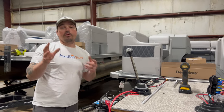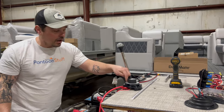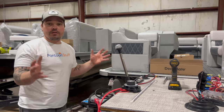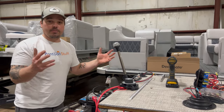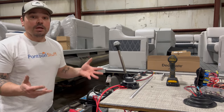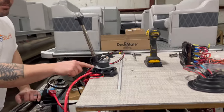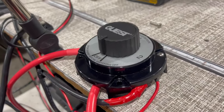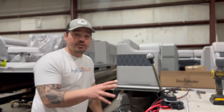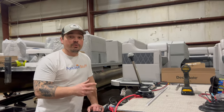The beauty of it is when I'm done with my boat for the day, I still have that off position that I can switch to — and then I have zero draw from my accessories or my motor. I've killed power out to the boat, so my batteries aren't going to wear down as long as they're a good healthy battery. One really important thing — and it's labeled right here on the switch — stop engine before switching to the off position. If we turn this to the off position with the engine running, most outboards still have power coming from the engine to charge your batteries. If I turn it off, that power has to go somewhere — it's going to do damage to your motor.